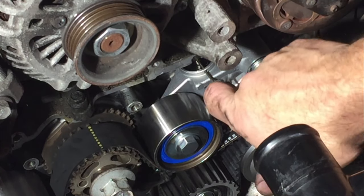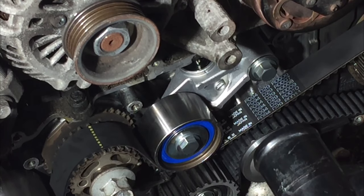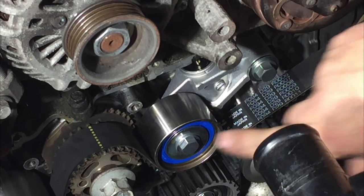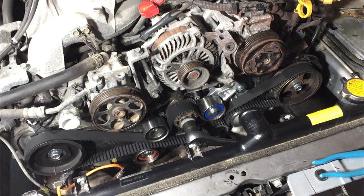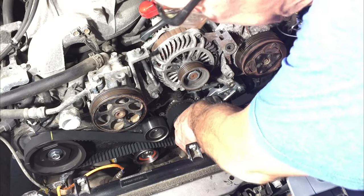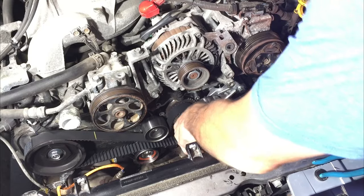It's time to pull the pin. So now I'm going to rotate the motor a couple of times. We are timed here in the mark, there in the mark, and there in the mark, and straight. So now we're going to turn it over a couple of times, just going to start turning it over, and then we'll get the marks back here and we'll reevaluate how our timing looks.